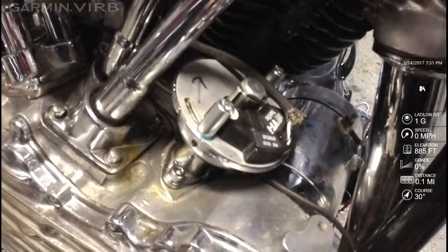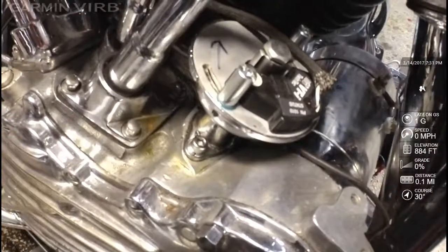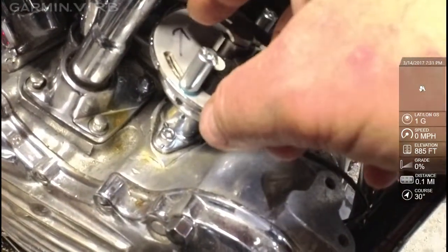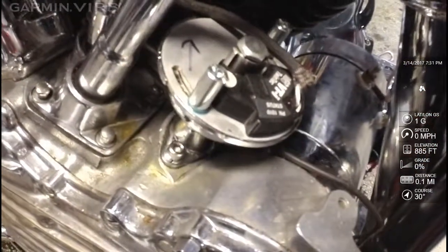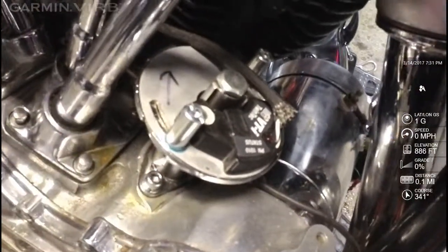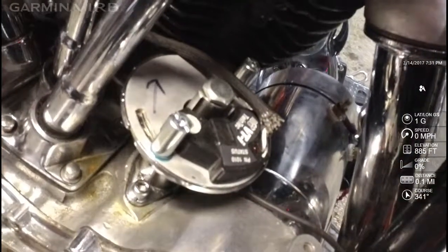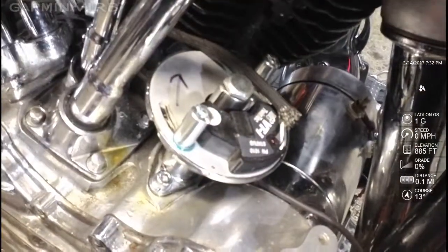So don't let the instructions completely fool you. Another thing that can happen is that the weights from the other engine fit into this distributor. I've heard of this type of distributor with the counterclockwise weights in it, which is a mistake — it can't possibly work. You can time it to start, but then it won't rev up. So that's it for today. Maybe tomorrow I'll have some more.